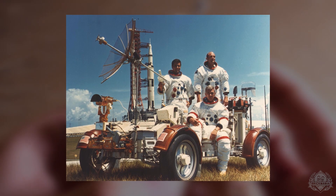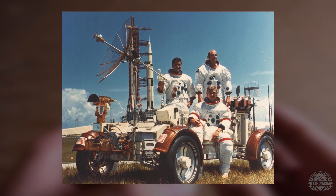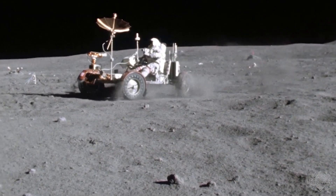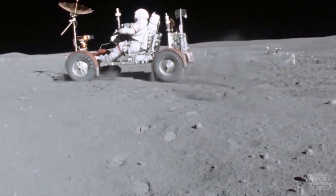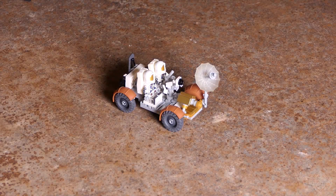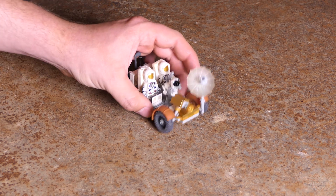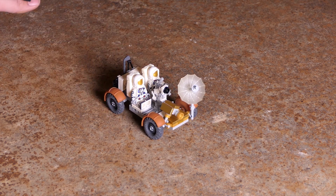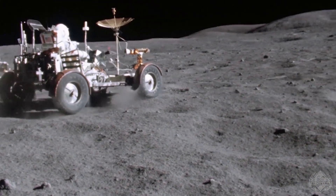The fenders on the real rover weren't just there to look stylish — they served a very important purpose. Earlier lunar missions let people know what the lunar regolith is like: it's incredibly powdery, like talcum powder, because there's no water to allow tiny bits of sand to stick together. These fenders were actually there to keep dust from being kicked up onto the astronauts and instruments. On Apollo 16, they broke one of the fenders, and it ended up covering both astronauts badly in dust and the entire rover to the point where it actually started overheating, because the dust created an insulating layer that no heat could radiate away from the rover.